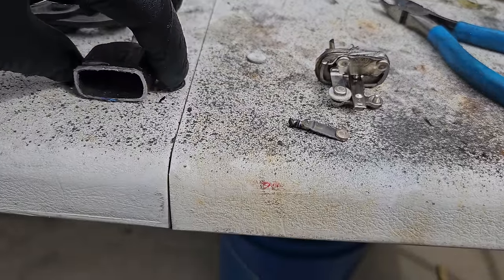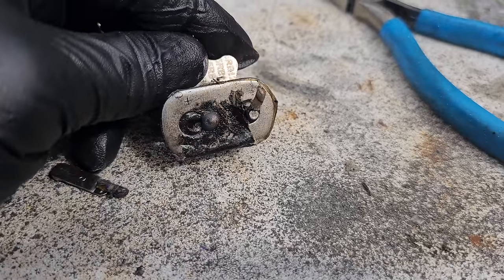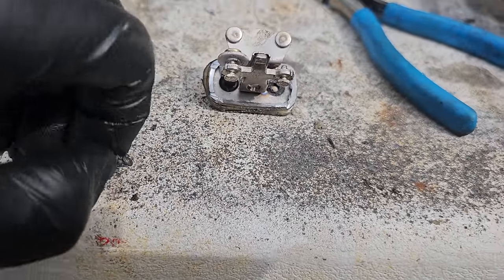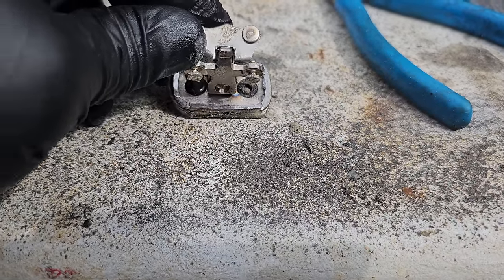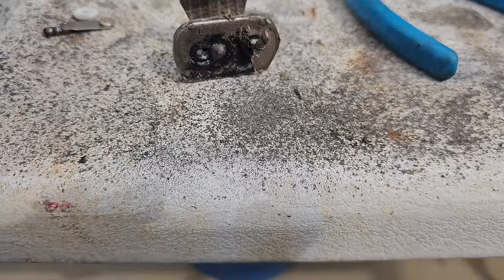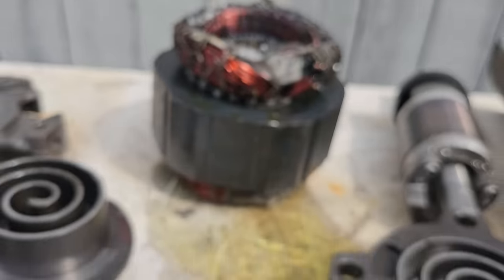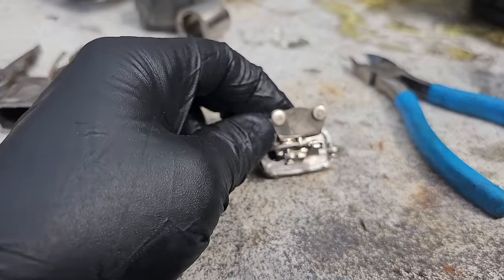I can already tell this had broken off because that is sticking out this end, and you can see a little piece of molten metal right there from the metal melting. But if you look in here, there are signs of the overload clicking on and off — look at the points where these two meet; that goes click, click, click. This guy was clicking on and off on overload, and for whatever reason this terminal completely melted off. That wire right there — that piece of copper was the wire that used to go to that terminal. So it literally went like that. Yeah, this guy died a premature death.